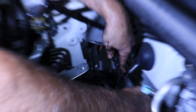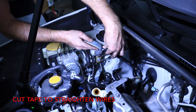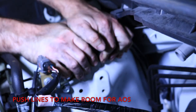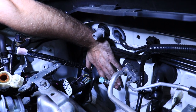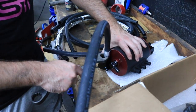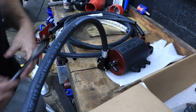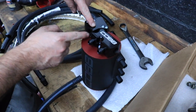You've got to be very careful — you don't want to cut any wires. Alright, now we get to the fun part: the AOS. So we're going to be taking this hose here and putting it right in here. You're going to be using a seven-eighths wrench — nice and snug, like a bug in a rug. Next, we're going to be taking off this piece here so it's easier to tighten when we put on this hose over here, so we're not hitting the paint or anything.